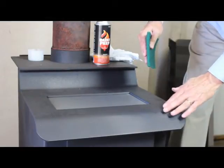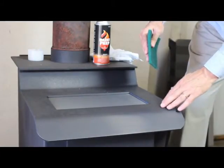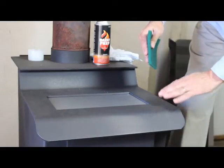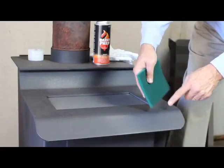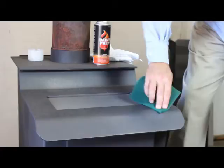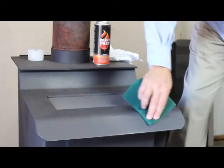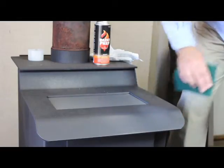So what we're going to do is prepare this previously painted surface. As mentioned, I've determined this is good paint that's compatible, so I'm going to go ahead and use a scotch-brite pad and scuff the surface. All I'm doing is pulling up some of that nice smooth paint to make a rougher surface for my new paint to attach to.